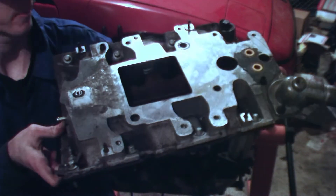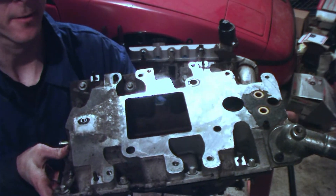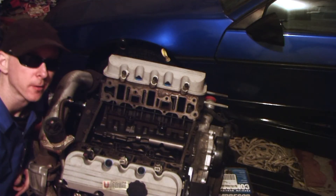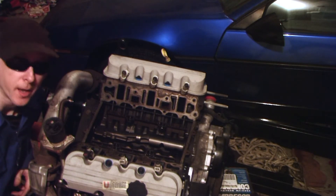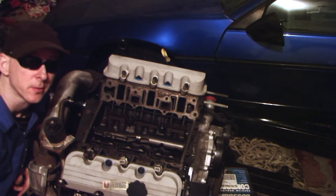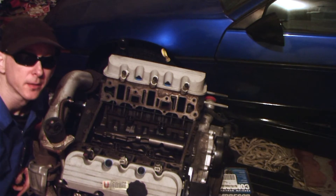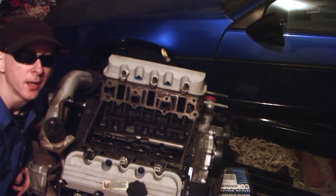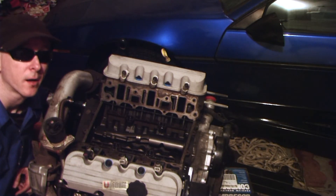There we have it — we'll go ahead and set this aside, clean it up, change the gasket, and get it all back together. I got the components all cleaned up: the lower intake gasket and supercharger are all cleaned up, got the old gasket scraped off and checked everything out. So we're good to put the new gaskets on. I'm going to go with a Felpro kit, model number MS98014T — that is a complete gasket set for the intake on a supercharged version of the 3800.